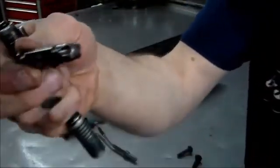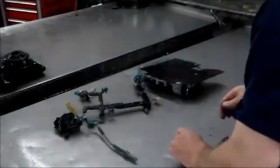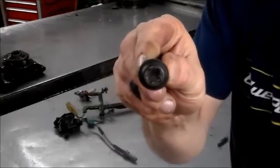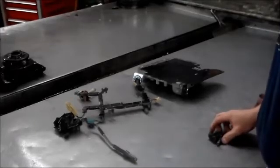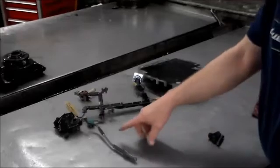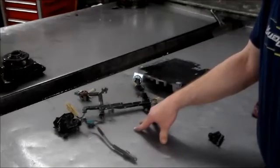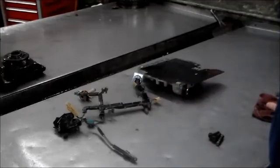This is the new style bit for those bolts. If you have a regular one and you order replacement bolts for a 4L60E, you're going to get the new style — that already happened to me, so I had to buy the new bit. That's about it for the running changes on the 4L60E. None of this will retrofit to previous models — the only thing that might work is this rod, which may be the same length except it has this flat here. Other than that, it will not retro back. Have a great day.